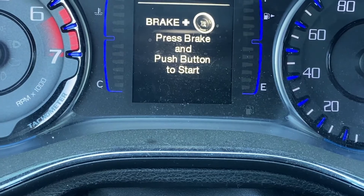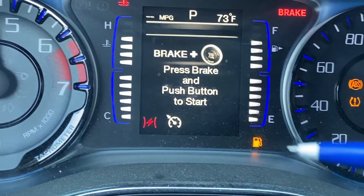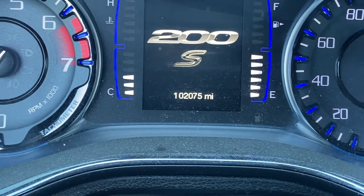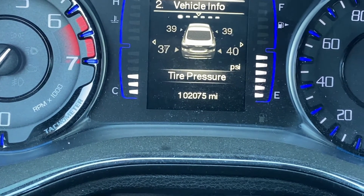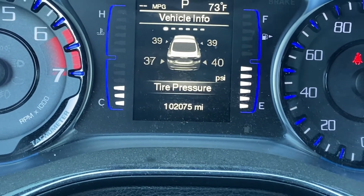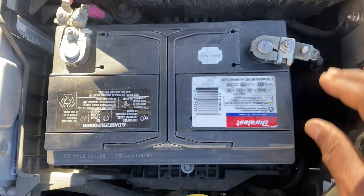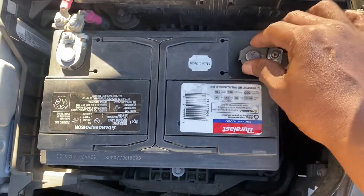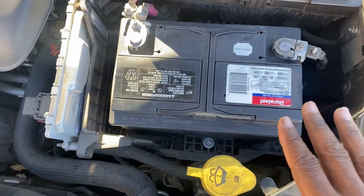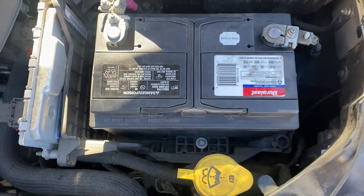One of the ways to test your battery or to see if it's working properly is to turn on your car. Now, if that battery light comes on and then goes off after a few seconds, that's fine. But if it stays on or if it comes on during your transit or when you're driving, that can mean some problems. It can be as simple as a loose cable or connection, it can be the alternator, it can be faulty wiring in the car itself, or it can be damaged cells or plates in the battery itself.